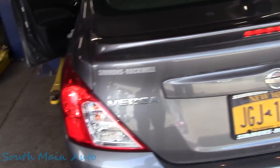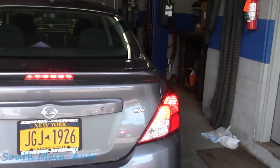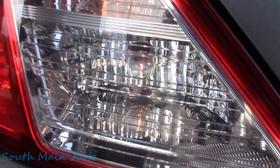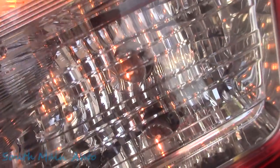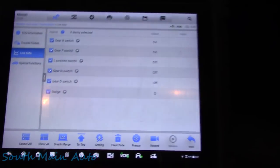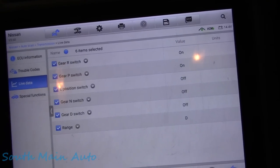Let's turn on the hazards and see what happens. Now look at that - that one's blinking, but look what's going on over here. We've got a bad ground because our reverse light's blinking. Our turn signal is a little dim and that thing's going hairy. Both plate lights are on - the plate light was off when I brought it in. This reverse light over here is screwy too. With the brake pedal depressed, the hazard's on and the marker light's on. Service data said: we're clearly in Park, but it says we're in Drive, and we have two switches on. So we have the criteria for this code to be set.